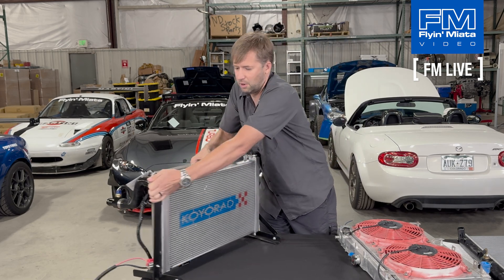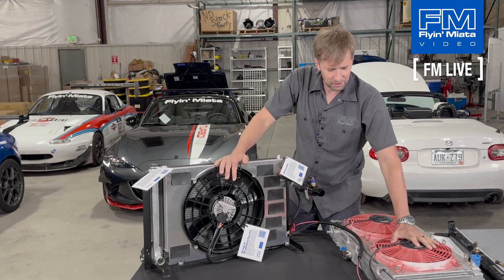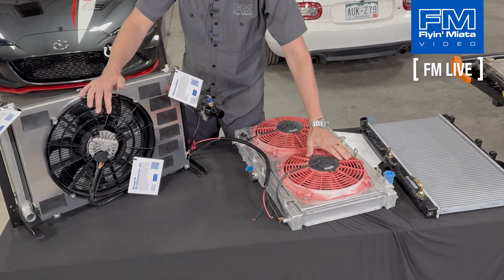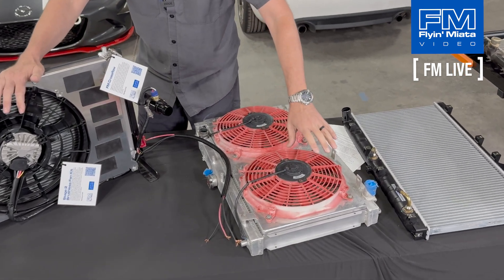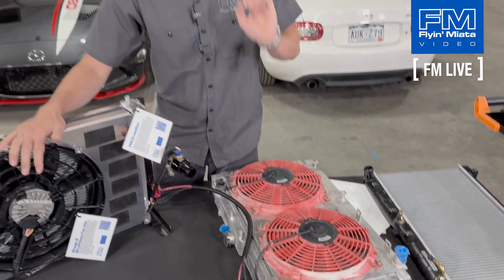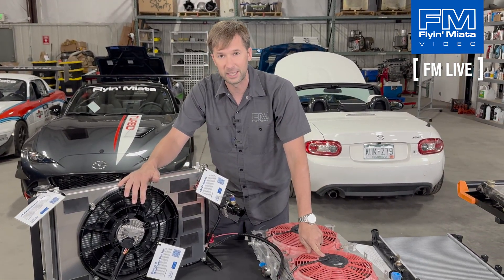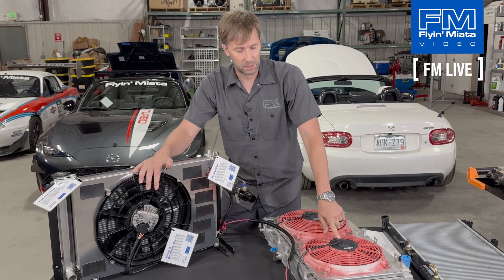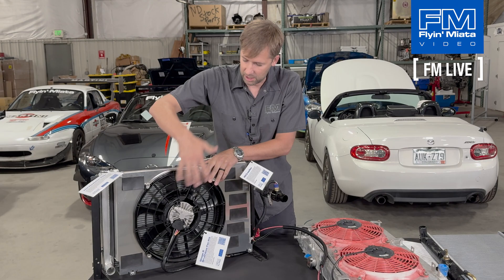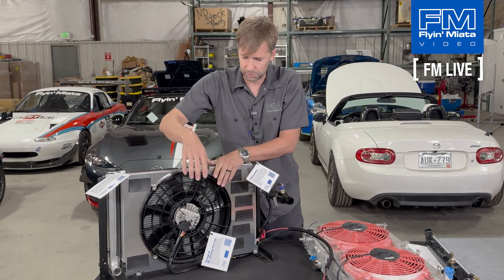I want to take a moment to point out airflow. These are so-called 'high flow' fans — heavy emphasis on the quotation marks. They pull 80 watts. That is a good indication that they are almost definitely worse than your stock fans. If your fans have a very shallow motor like this, don't buy them. Stick with your stock fans — the stock fan pulls a bonkers amount of air and can make a huge difference, particularly to the effectiveness of your air conditioning.